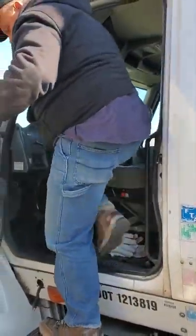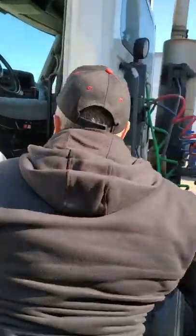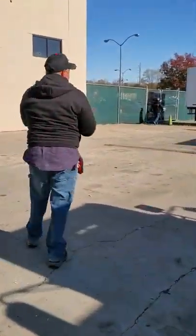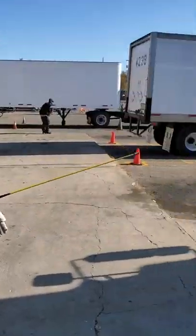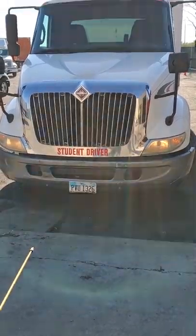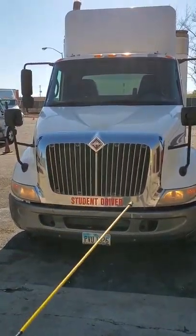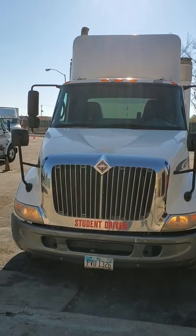Get out, get ready to do our outside truck. I'm going to pop the hood on the driver's side. As I approach my vehicle, it's not leaning to the left or the right. There's no puddles indicating leaks. There's no wires hanging down and no debris. My clearance lights, turn signals, and my marker lights are all amber in color. They're not cracked, broke, or missing any lenses.